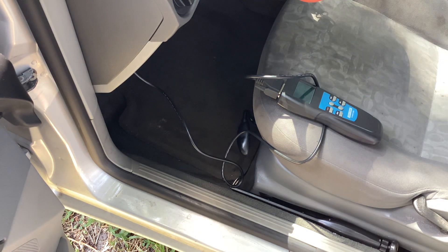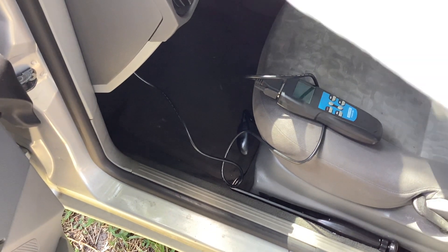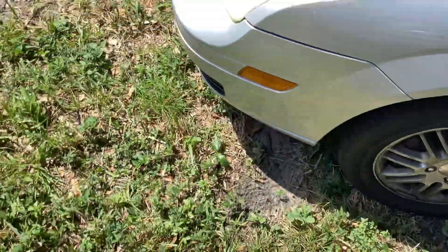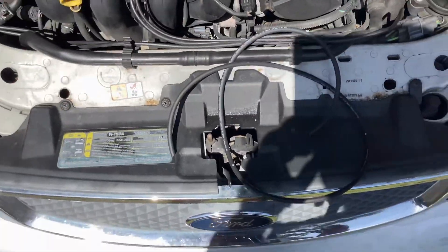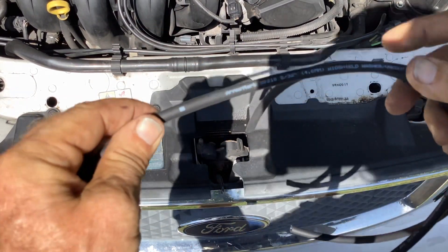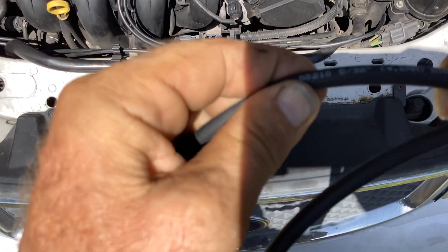The car's got 105,000 miles on this Ford Focus. Let's bring you around to the front. I pre-bought some vacuum line — it's vacuum line slash windshield washer tubing and I got it for about a dollar a foot at AutoZone. The size is 5/32 inches.